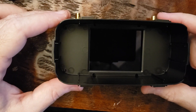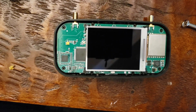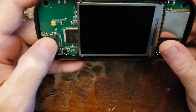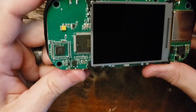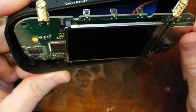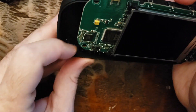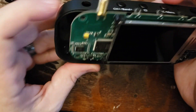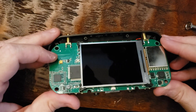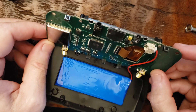Just keep pressing down and make sure you don't strip the screw heads and it will eventually come out — once you feel it, jump for joy. Now you pull off the shroud, it should come right up and exposes the board with the diversity antennas and the LCD screen. From here you can see everything. I just tilted the board up using the antenna holders and was able to pull out the module. Once the module is out, look at your handiwork, make sure you don't lose any of the buttons because the little plastic push buttons tend to pop out very easily. You can also look at your antennas and receiver — make sure you don't smudge your LCD screen, or if you do, clean it with alcohol.